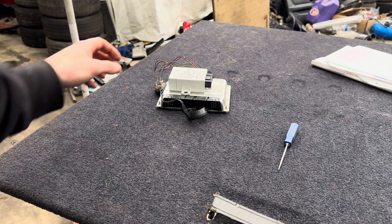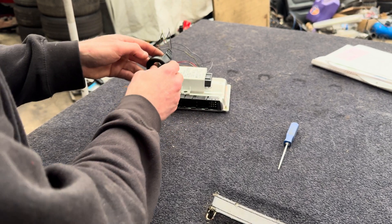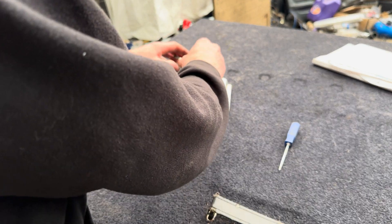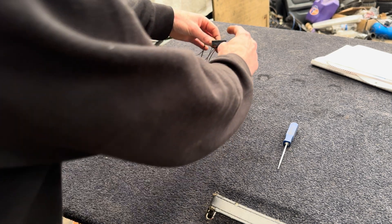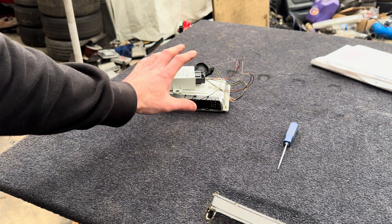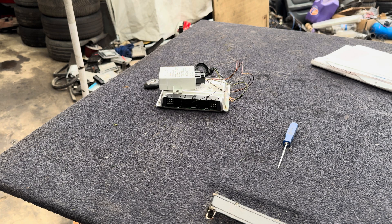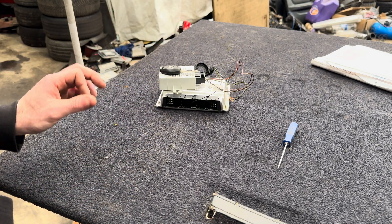What you could do is get that stuck into there, take the chip out of the key and just tape it to the antenna ring. When you wire up your motor, just have all that taped together in one place. That plugs into there — you earth it, live it, switch live it — and your other ECU plug houses this, and then everything runs no problem. That's the easiest way to cover EWS3. It's fairly basic as a form of security, but if you ever lose the key or the chip you'll need an immobiliser delete — there's absolutely no way around it.